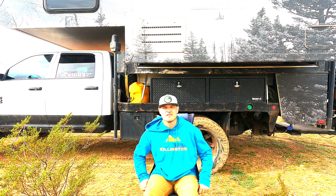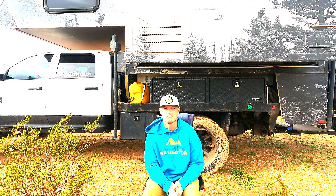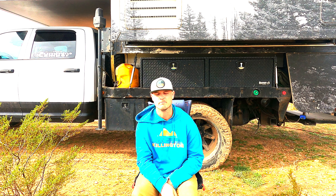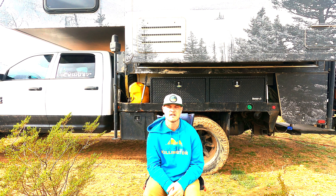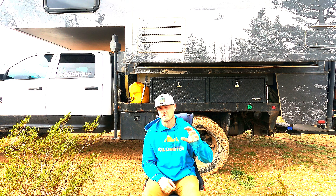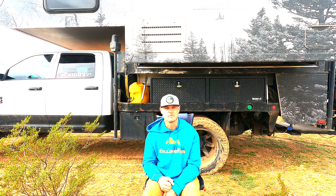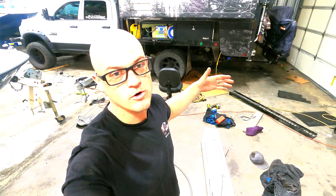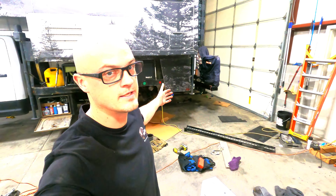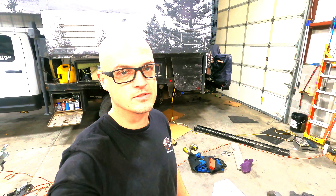This is my confessional — I blew it. I failed to continue to film the rest of the axle repair saga. The synopsis is we were able to get everything put back together, got back on the road, and then we had more problems. That parking brake that I thought I had dialed in, I did not. It was continuing to drag inside the hub assembly, creating friction and heat. But once we adjusted it and backed it off a little bit more, we made it to Pleasanton, California for Tiny Fest. Ever since then I've been doing temperature checks on the axle and everything's been fine — we haven't exceeded about 130 degrees on the wheel bearing area even on hot days. The last and final upgrade: we're upgrading our axle shafts to chromoly axle shafts from Yukon, cut down to the factory length of our truck.